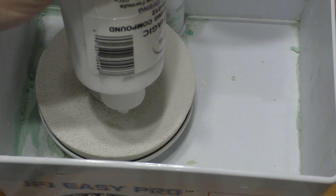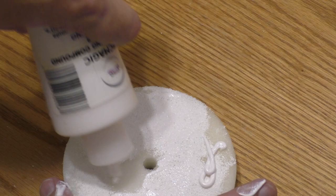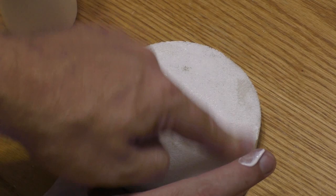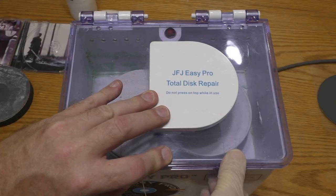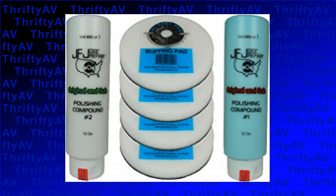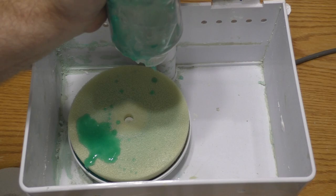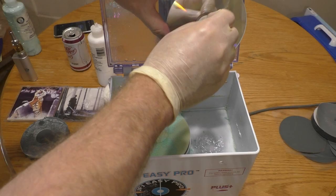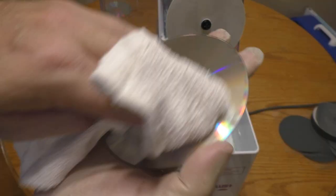For light scratches, I don't use the sanding pads. I place two dabs of white solution on each side of the polishing pad and wipe it into the pad with my finger. For a brand-new polishing pad, I use more white solution, making sure the entire pad is covered in a thin layer of white. You can apply the polish either before or after you insert the pad into the JFJ unit. I use the one-minute setting for the white solution, then look at the disc. If I still see scratches, I'll add a little more white solution and run it for a minute longer. The pad dedicated to the white polish should only be used with white polish, and the pad dedicated to the blue polish should only be used with blue polish. I run the blue polish from one to two minutes after the white polish, removing the disc and wiping it with a clean rag.